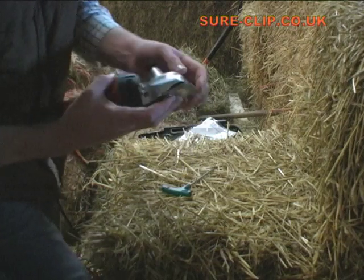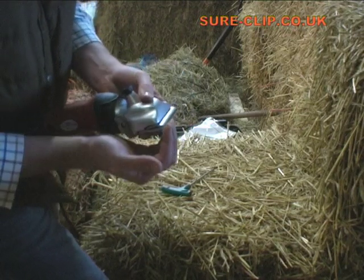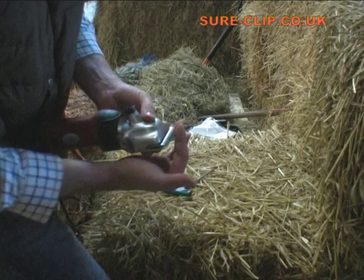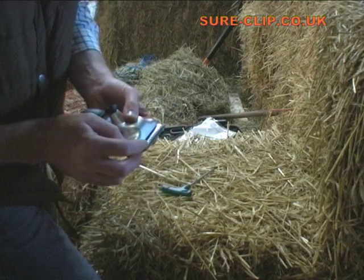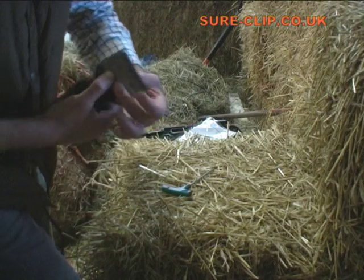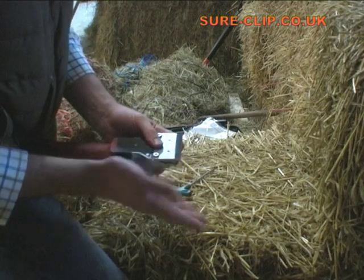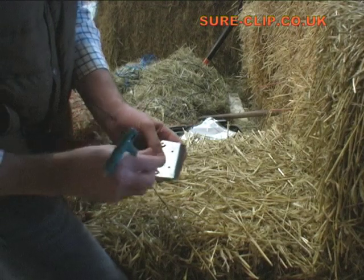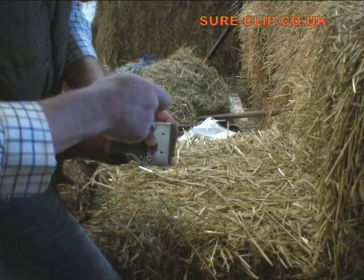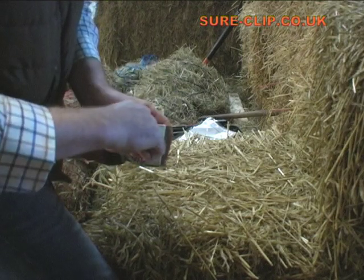And that's the idea behind having the two screws, so that you can get the right length. Basically, what's happening is you will want to set it up so the teeth are roughly two millimetres behind the front of the comb. The main reason for this is obviously so that you don't cut the animal or get any danger for the horse. So move this back slightly up to about two or three millimetres and then tighten it up with the tool. You might find this is a bit of trial and error, but once you've got the correct length, you'll find cutting a lot easier.